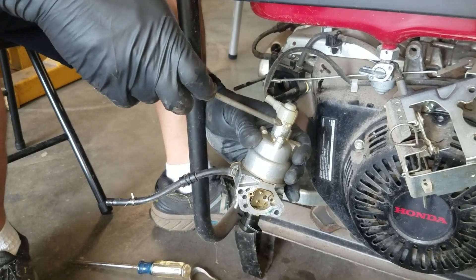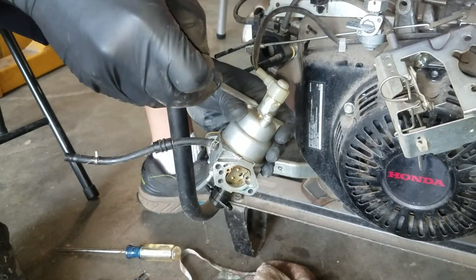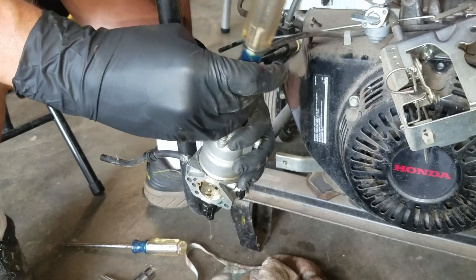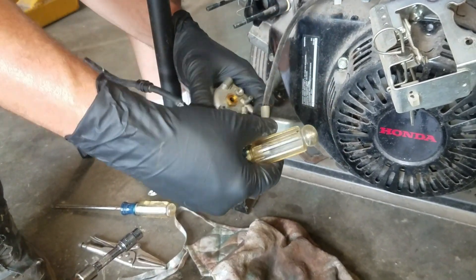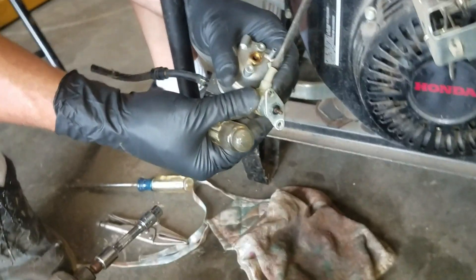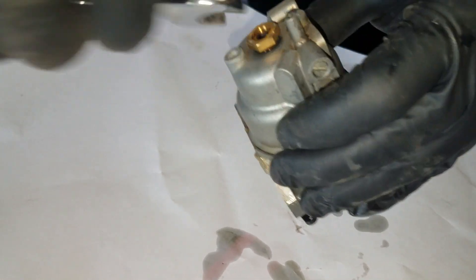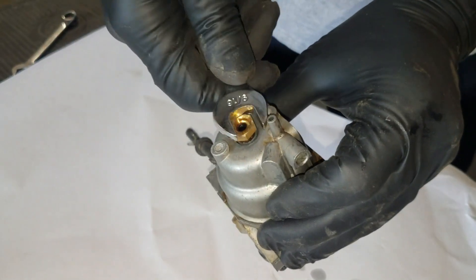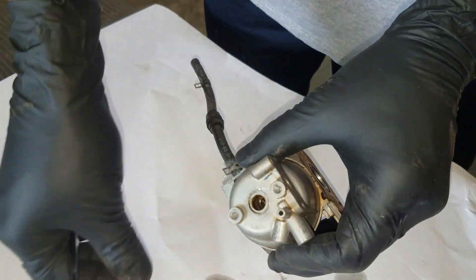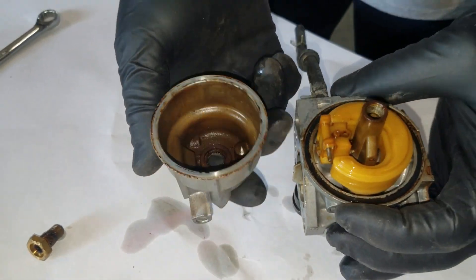This is a fuel stop — it's kind of like an anti-backfire. Not all carburetors have these, but if yours does, they'll unscrew here. The Honda unbolts from the bottom, so we just get these loosened up. We'll go ahead and get the fuel bowl off. Basically a nut on the bottom holds the bowl on, so remove it. Yeah — it's brown, all of that. There is no way this thing would have cranked.